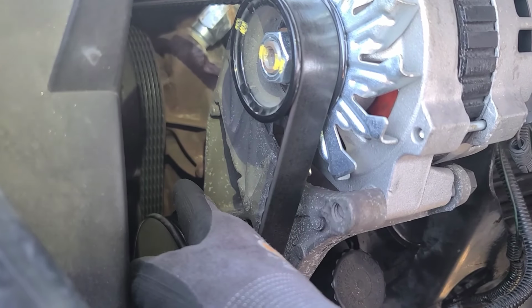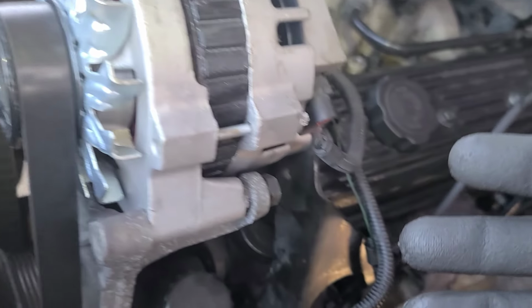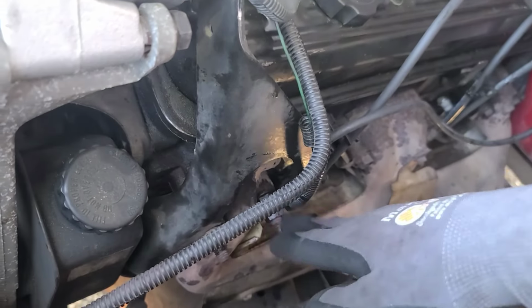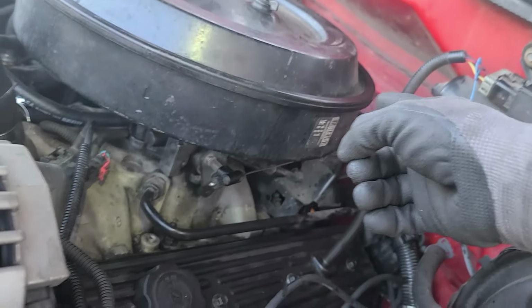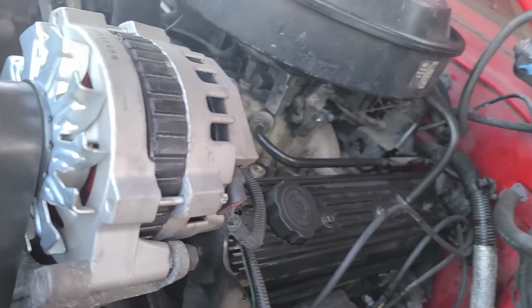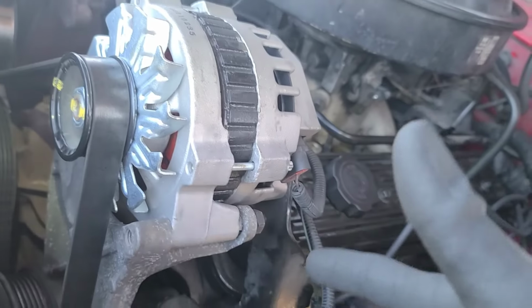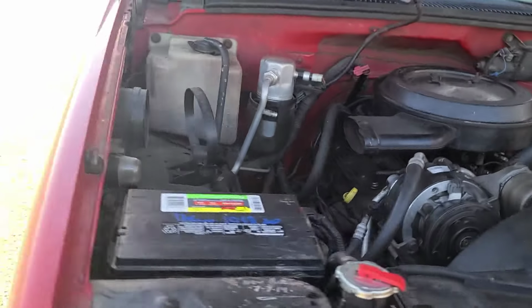Bring that indication mark all the way up to 0, right at top dead center. I even got my little camera to put it in there and make sure. These were loose. Piston was at the top. Set your rotor. Make sure your timing's there. Bolt everything back in. Disconnect that wire. Turn it on. Start adjusting. And that's it. It's pretty simple.